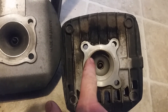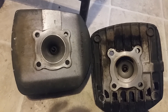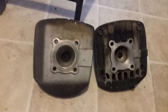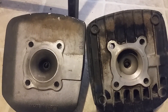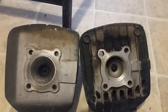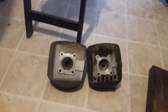It looks like I'm getting some carbon buildup on the exhaust side. Other than that it's the same head — it'll bolt right on, requires the same head gasket, same bolting torque, everything's the same. So the difference is: this is a high compression head, this is a low compression head. The high compression is going to give you more efficiency; the low compression head is going to have less compression and provide less torque for the motor.